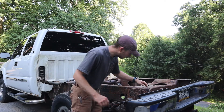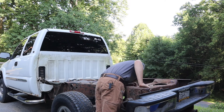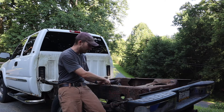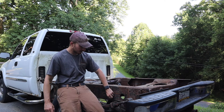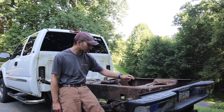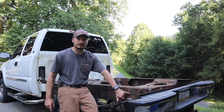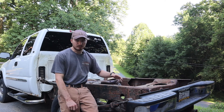The spare tire crossmember is also not very good. I have to do some more investigating to see if it can be saved, but basically it sits in here and there's a band of metal that wraps around the back side of this mount. It's bolted on from the factory at GM, and we're going to have to cut this off whether we use this crossmember or buy a new one. We'll probably bolt it back on with grade 8 or 10.9 hardware so it can be removed again if necessary.